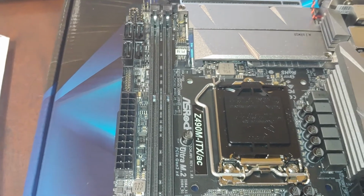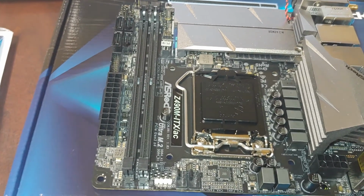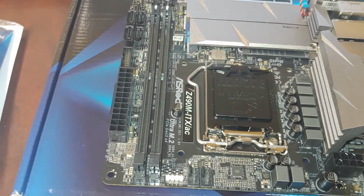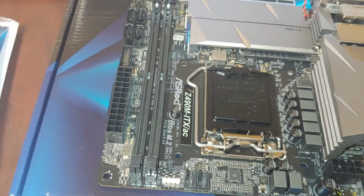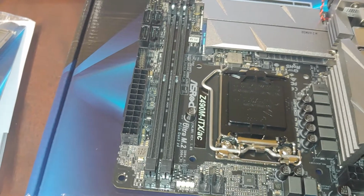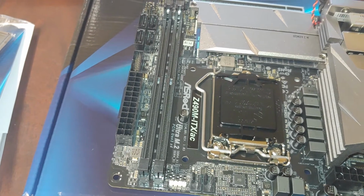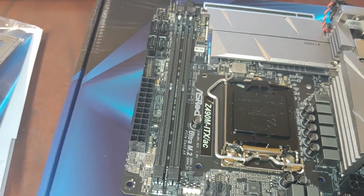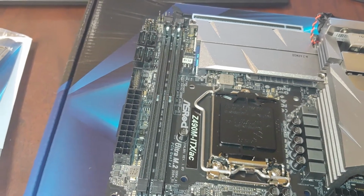Now, when I say go with 2, that means if you want the dual channel configuration, you always need to install identical modules. At least they should be identical: same brand, speed, size, and chip type in your slots there. If you only have one, which a lot of times I'll stick one in there more for testing, then you're not getting dual channel. Of course, just like the manual will say when you read it, DDR4 only. Don't try and stick DDR 1, 2, or 3 in there. That'll be a huge mistake.